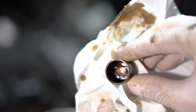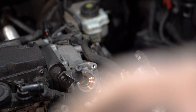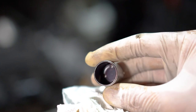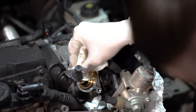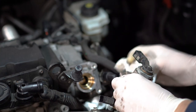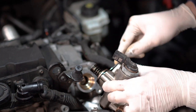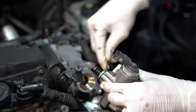As you can see, it's a mirror finish instead of a hard coat. Here you can clearly see how the new cam follower looks — it's completely black and hard-coated on the inside as well. Make sure to clean the mating surfaces of the fuel pump so you don't have fuel leaks or pressure loss after you replace the cam follower. Now remove the old O-ring — it will actually break. Also make sure to clean out the groove so the new O-ring sits in properly.